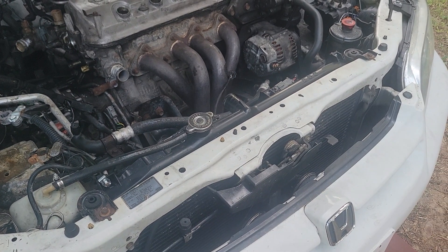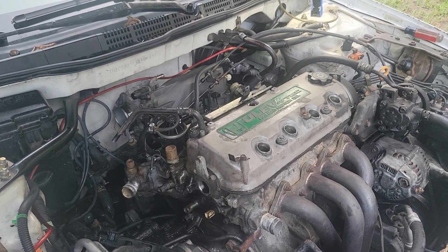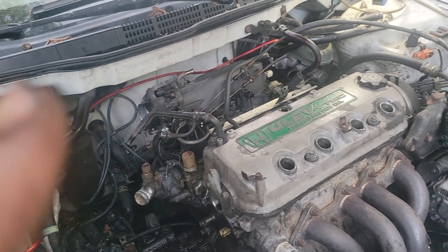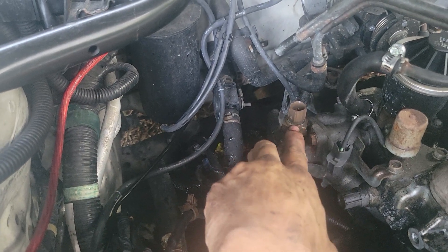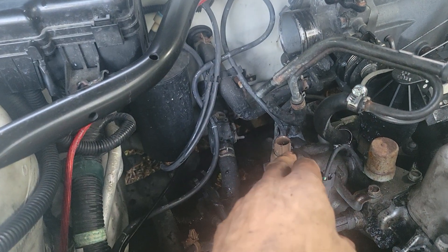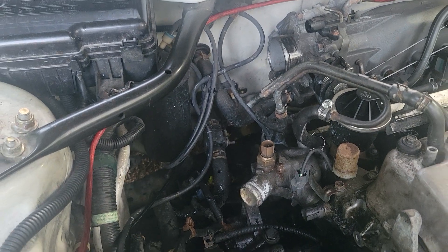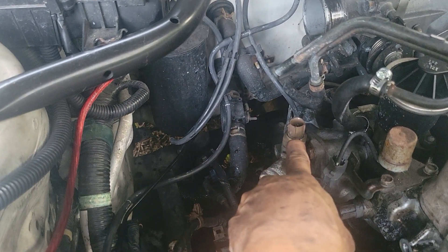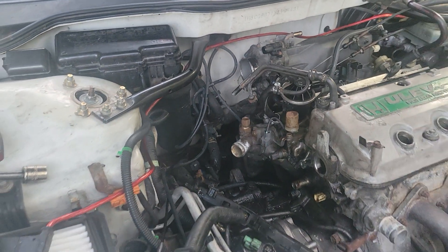The 98 to 2002 Accord is the world's worst for the hot and cold hands not working. I'm going to put an aftermarket gauge on this thing and make a video of installing it. The second thing these cars have a bad history of is your fan switch sensor right here - they go out. Even if you put a brand new one on it, it might be something going on in the harness somewhere. So I always bypass the sensor and it just makes the fans run all the time when you turn the key on. I'll probably just take this sensor out, leave it out, and put my aftermarket gauge sensor in here.